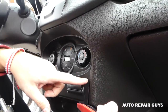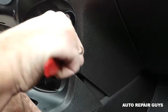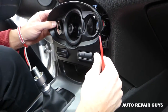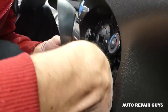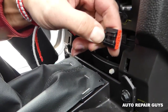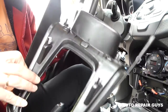With the plastic removal tool, there is a clip here and one clip here. You have to be careful — sometimes they will fall off, so you have to hunt for them once you remove the panel. There are two more clips working your way up. Now you need to disconnect the wires. On the bottom side you have a tab that you press down, right here — press down and pull.